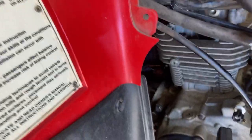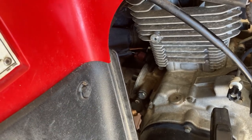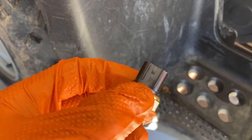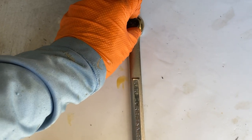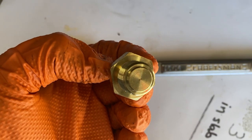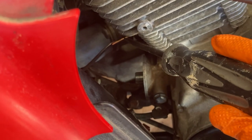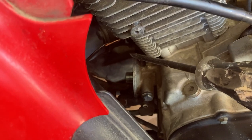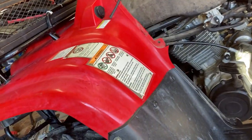Alright, that part's done. I got the filter off and out of the way — all that had to happen because one of those wires goes to the oil temperature switch. I got the electrical plug off the oil temp switch. It's a two-prong plug. Here's the new one — you can see the little latch and the keyway to line it up. I compared it to my wrench sizes and 15/16 — despite the rest of the bike being metric — should take out the old plug. The old plug sits right in oil. That colored wire goes to the fan switch; when that sensor reaches a certain temperature it turns on the fan. And the item I'm replacing, the oil temperature switch, is what turns on the red light in the dash.